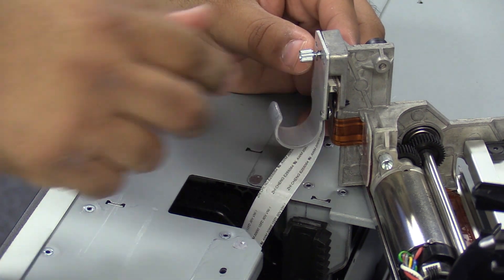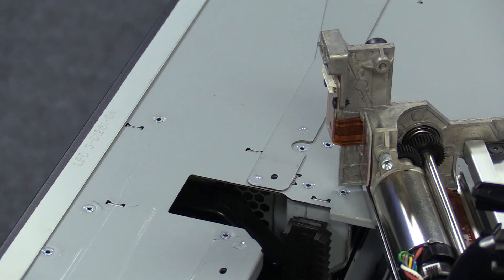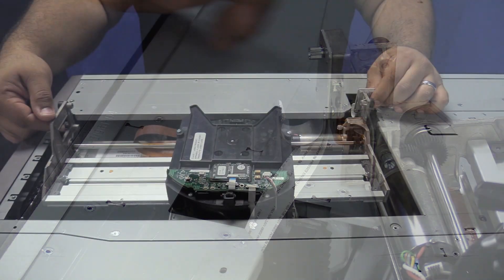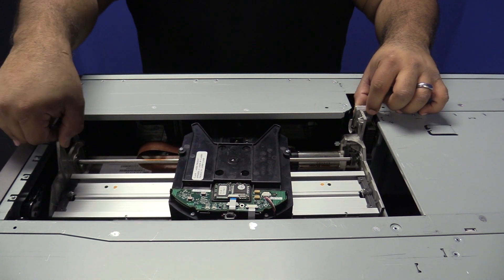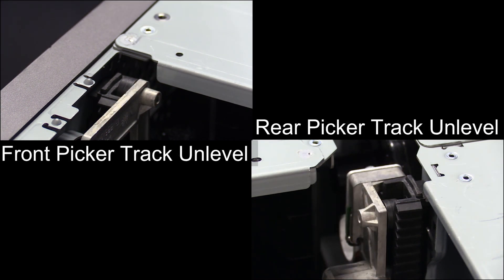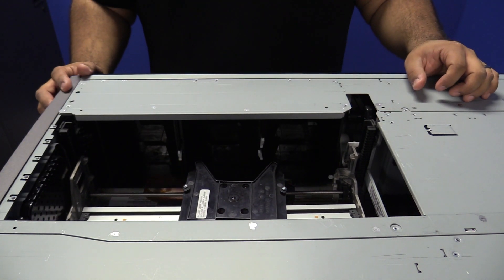Once this screw is undone, you can remove the cable carefully and let it retract back into the control unit and set the faulty picker aside. You are now ready to install the replacement picker. To install the picker, first connect the picker cable to the rear connector of the picker. Then carefully line up the front and back wheels with the guide channels going down the tracks. Lower the picker carefully, ensuring that it is level front to back. To be sure this is the case, compare the positioning of the topmost wheel of the picker assembly with the top edge of the track, both front and rear. What you want is for the top edge of the wheel to be even with the top edge of the track for both front and rear tracks simultaneously. If one wheel is either a bit above or a bit below the edge of the track, you will need to pull the picker out and try again. This may take a couple of attempts, even for those experienced in replacing these assemblies. Please don't get discouraged, just take your time.